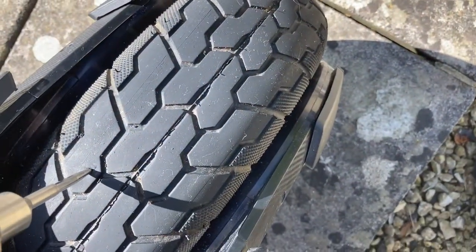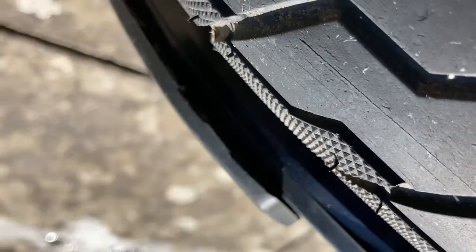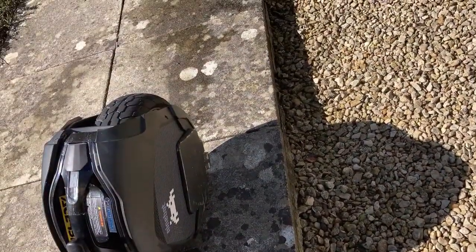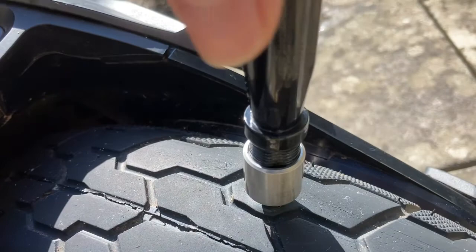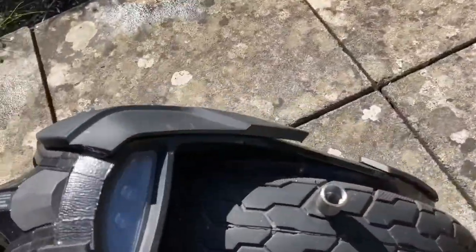So the prodder goes in like that, all the way in, until the funnel itself is sitting in the hole. And then you're supposed to unscrew the prodder, so you're leaving the funnel sitting in the hole. You're basically now ready to receive the mushroom plug, which is sitting in your plugging tool. So let's go and sort that bit out.